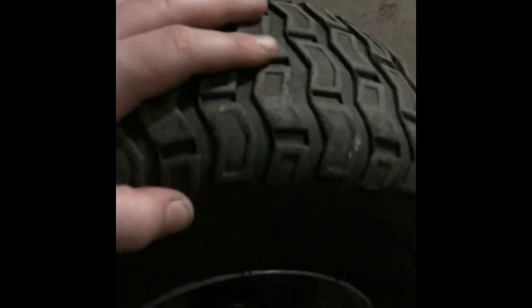Check the tires and wheels — look at the sidewalls for cracks, because someone might air them up and then you get home and they're flat. If there are cracks, they'll dry out and won't hold air. You'll probably need to put tire tubes in them. I had to do that with these tires because both of them wouldn't hold air. Putting tire tubes in tires is a lot of work, so keep that in mind.